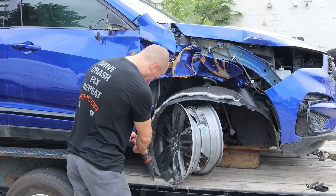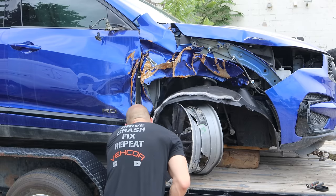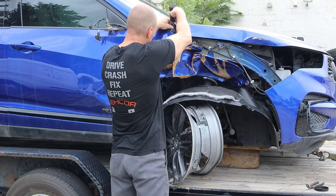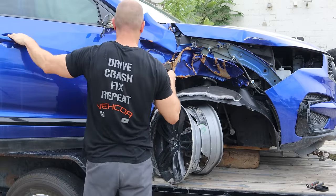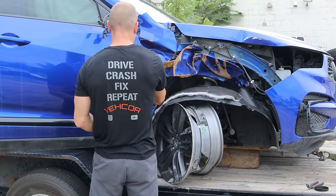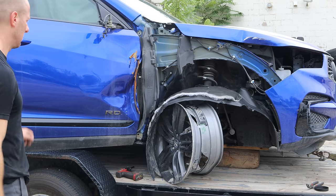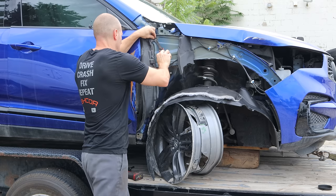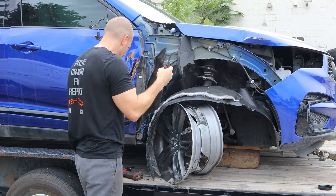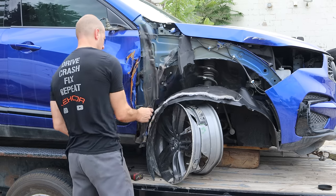First, we're going to remove what's left of our fender. I want to get it out of the way before I work on the car so I don't damage it. I'm pretty sure we could buff that little scratch out of there. There's one bolt at the bottom, one back on the hinge, and one inside the door. There's supposed to be a few more, but they got taken out. I'm going to pop the pushpin out of our little foam filler here — there's supposed to be one at the bottom but it didn't survive.